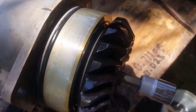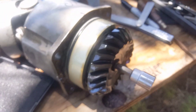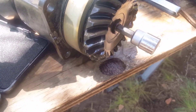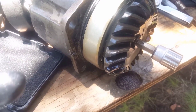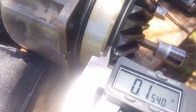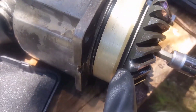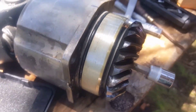The other thing you want to look at if you don't have the appropriate feeler gauges is to use a micrometer. I actually took my micrometer — it's kind of a poor man's way of doing it — and there is no play. You're going between the race and the inner part of the pinion gear. I got 0.1535 of an inch; it kind of varies between 0.154 and 0.1535, just for your own edification.